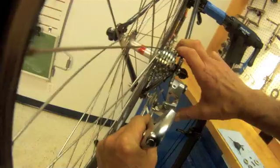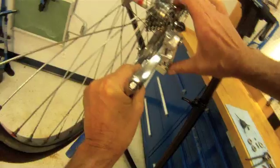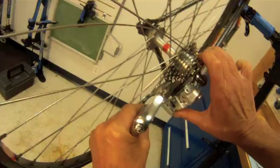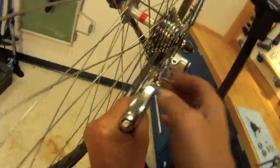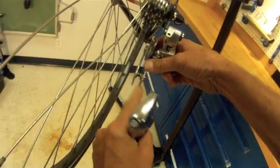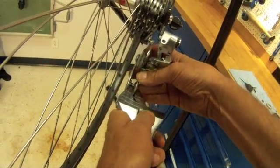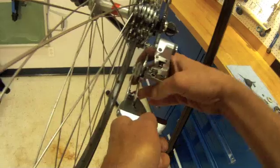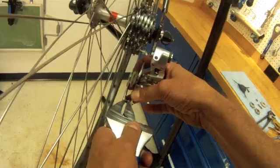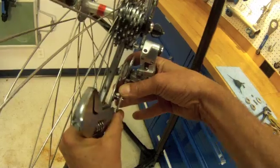Let's see, we're moving pulley to cog here, pulley to cog there. That's not so bad. We got good spoke clearance. I bet we're okay. We are pointing straight to our chain rings. This lower one is a little bit worrisome. I think I want to come a little bit this way with both of them. And again, that's why we've left that bolted together there.